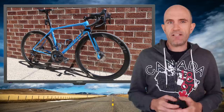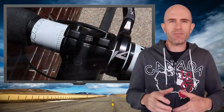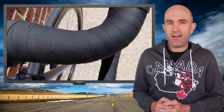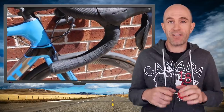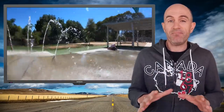In my first new bike video I discussed the handlebars not being quite right with my hands and getting the levers and hoods in the right spot. I raised the bars by about two millimeters — a very small modification that changed the ride entirely. I'm more comfortable now and may continue to tweak that. A few questions came in about the bar tape: it's BBB Flex Ribbon tape. I'll put a picture up and links below. It's nice and grippy, works even when wet, and I'll be going back to it for my next project.